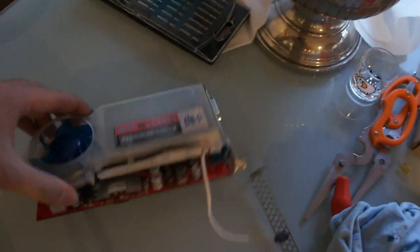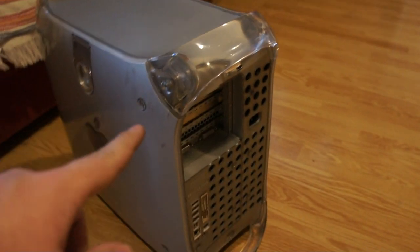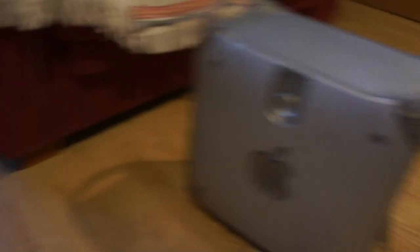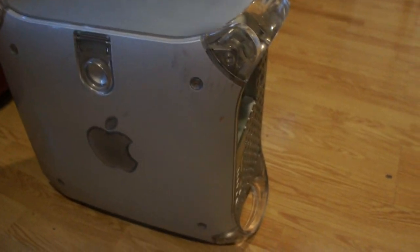The original CPUs are stored in a nice anti-static bag along with my dead 9800 XT — rest in peace. This is my computer now. I have to configure the bus on the motherboard to run at 167 MHz, which is no big deal — just soldering two resistors, two jumper links.